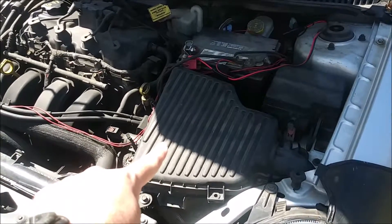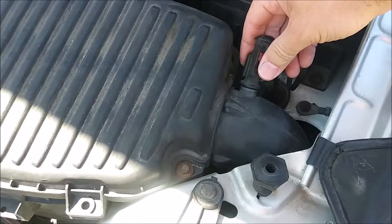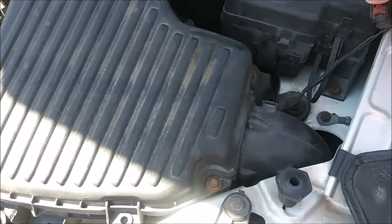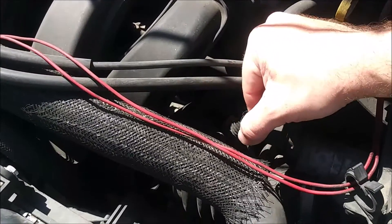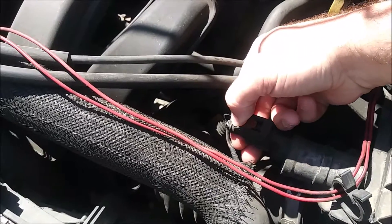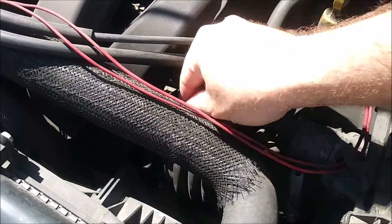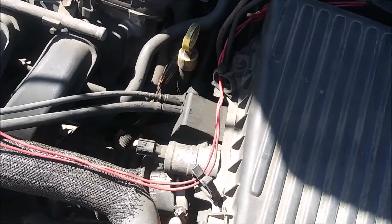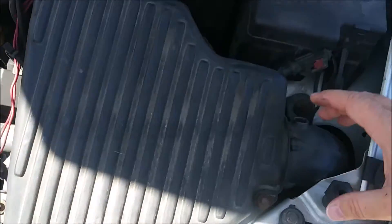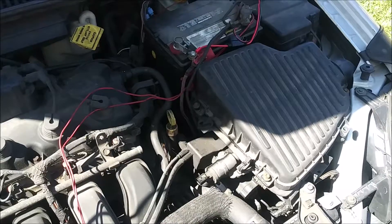The target sensor is underneath this air box. First order of business is to pull your red tab out of the way so you can remove this sensor, because this one needs to come out. Then we want to get this one out of the way as well. We've already slid the red locking tab back — squeeze and pull. You need to loosen this clamp down there, and then we should be able to lift the air box and move it out of the way to get to the sensor.